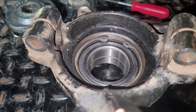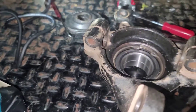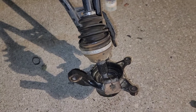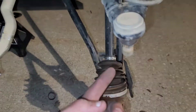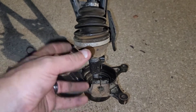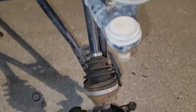It's in nice and pretty. Clean it up a little more — I got ahead of myself and almost went to put it back on, then realized I needed the snap ring. Don't forget to put your snap ring in before reassembly. When putting everything back together, put the bottom control arm on first. The reason is I tried top first and couldn't get the axle in while trying to smack it with the dead blow. Down here, you can literally just pick it up and it falls right in, then do the top.